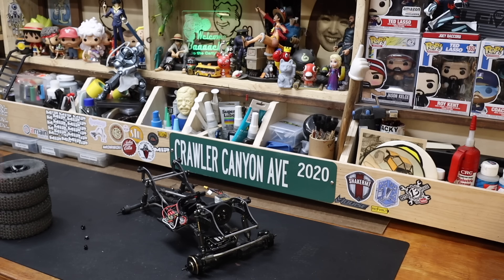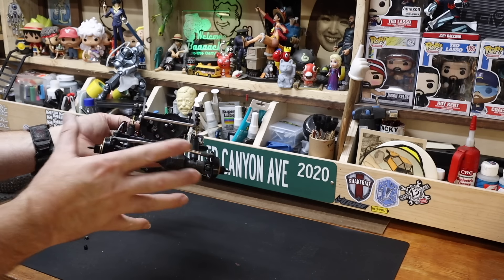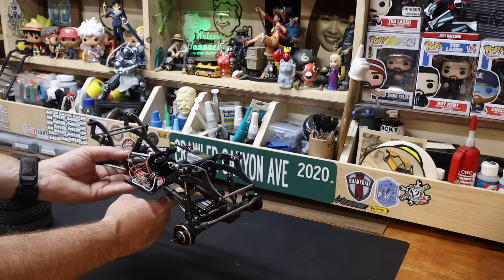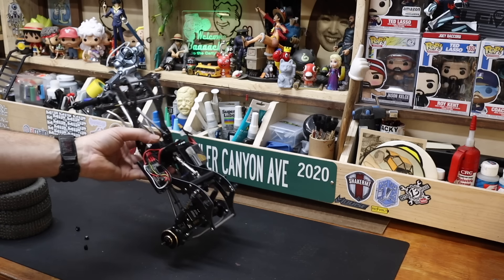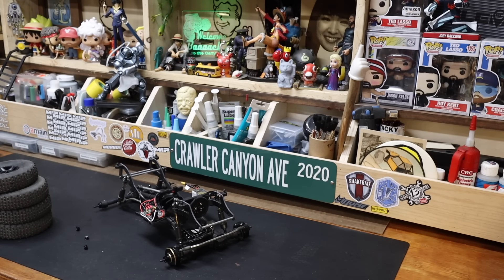We're going to put about 60-ish grams on the rear axle, because the CG on this is right about just past the back of the motor — there's nothing back there. As soon as you start to descend and get that weight transfer, there's just nothing. Weight has to go back on, because the CG was right around 62 to 63 millimeters when we were in the 2086 configuration, and we are now at 82.5 millimeters.